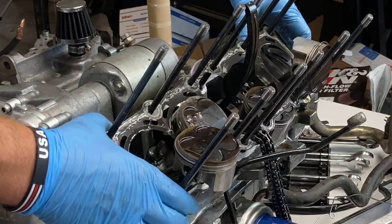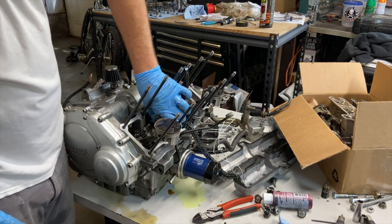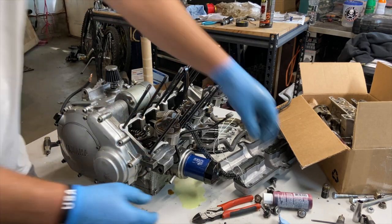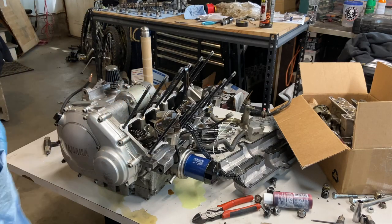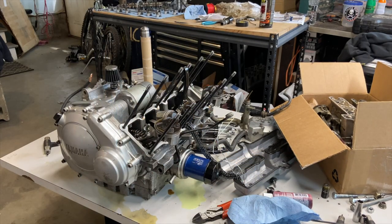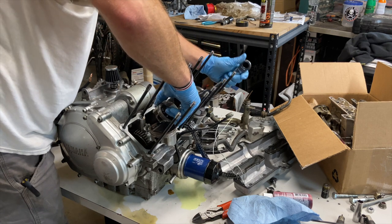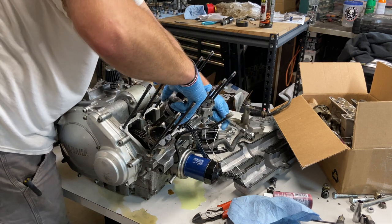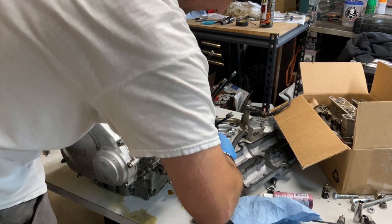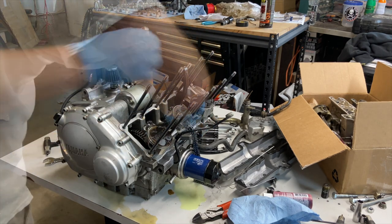Here's our bad piston. Now, this is actually gonna be pretty easy. It's seen better days anyway. There we go. So now I'm going to re-clock this to make it easier. We've already turned the engine, and we're gonna find top dead center before we put the cams back in anyway. So it's not gonna hurt anything to re-clock it to make it a little bit easier. Oh, look how fun that is. So we're just turning to 180. Cam chain's still on the gear, everything's still good. Gives us better access to this wrist pin here. That's cool.